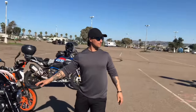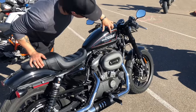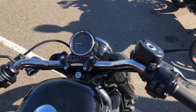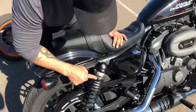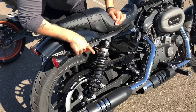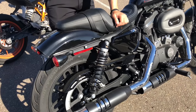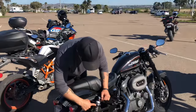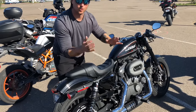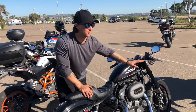Take a look at the 2019 Harley Sportster. Like most Harleys, it has non-adjustable suspension in the front. In the rear, it does have preload — there's a top collar that locks it, and a bottom collar you can crank down to adjust. If you weigh 500 pounds and it's sinking a lot, you turn the bottom collar down, which is like adding air to the air mattress. But there are no damping adjustments at all on this bike.